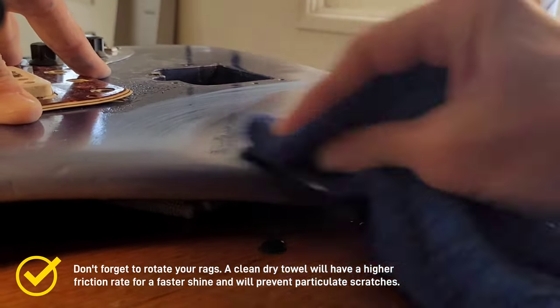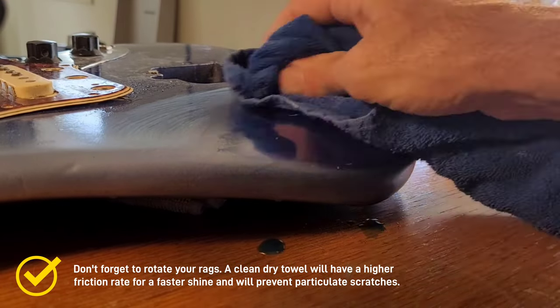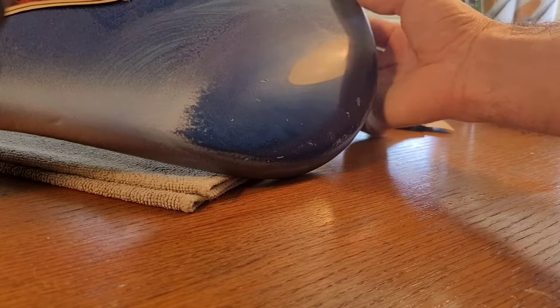So essentially, a lot of the quality of the finish is going to come down to after you've painted it, after it's already been done and it's already in color, and this part's going to make you want to throw up a little bit. You're going to have to take some sandpaper to that perfect freshly painted surface, and you're going to have to start sanding.